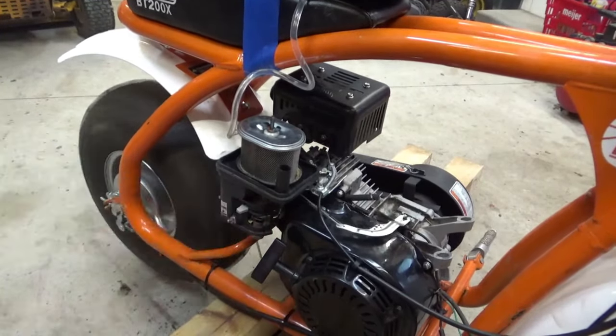All right, guys. This is where I screwed up. That witness mark on the camshaft needs to line up with the witness mark on the crankshaft. So I screwed the timing up, totally forgot to match those up when I reassembled it. So here we are with the engine back on the bench. I'm hoping I can pull that camshaft out